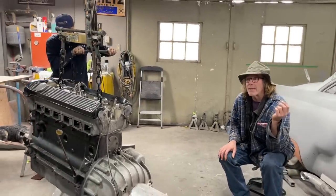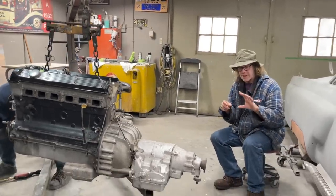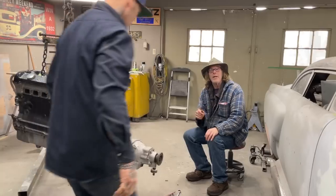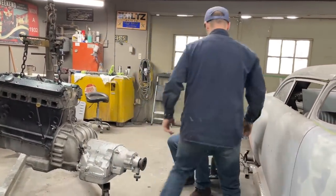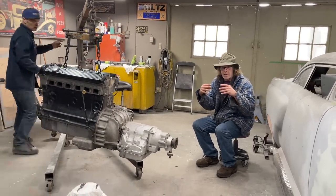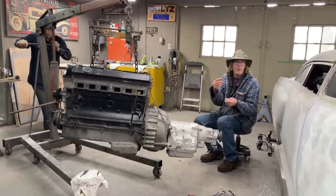Now, in some of the antique motors, they have cork gaskets. My understanding is, oil-free, put the pan on with the gasket, snug the bolts, and then let it sit for like 6 hours, then snug the bolts around again. And then tomorrow, snug the bolts again, and then put your oil in. And give it lots of time for the gasket to fit and slowly go into place, because if you over tighten it, all you're going to do is crush the gasket and bulge it out and push it right out.